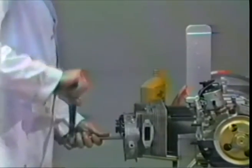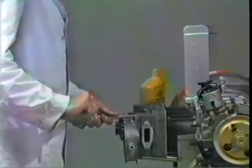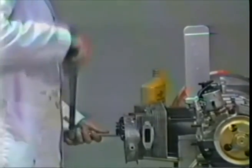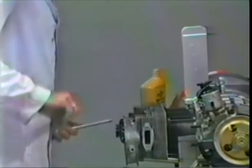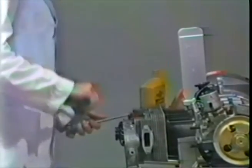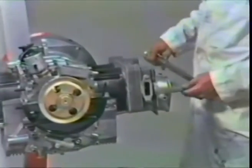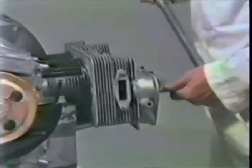Now, I know on American V8s and things, you're supposed to retorque the heads after the engine's fired up. Porsches are very seldom, if ever, retorqued, because you have to take the intake manifold off to get to the top row. A lot of guys would tell you they retorqued their heads after the engine's been fired up, are probably lying, or else they just retorqued the lower row, which they can get to by taking the rocker stand off. And retorquing just the lower row may make things worse, not better.